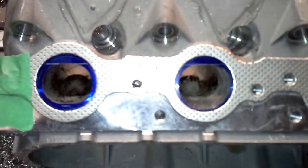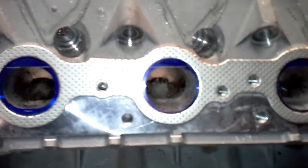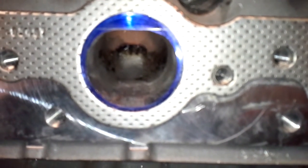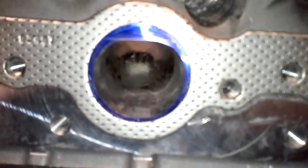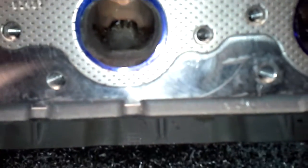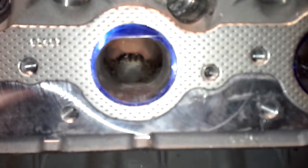I will generally contour that, basically just make it as rounded and somewhat flat as I can. But I try to deter people from cutting that thing all the way out and making it perfectly flat, because if you go to a double spring or some kind of really strong spring pressure in the future, you don't want to run any chance of cracking through into your port. It's not going to be detrimental to your port flow, because the sides — that little reinforcement bump for your spring pocket, which you run into a lot on the new Chrysler Hemi heads — you can basically take the ends of it off. Over here where the air is going to flow, on either side of the guide boss, you'll pretty much remove all that, then just contour the middle of it. You'll still maintain structural integrity and gain flow.